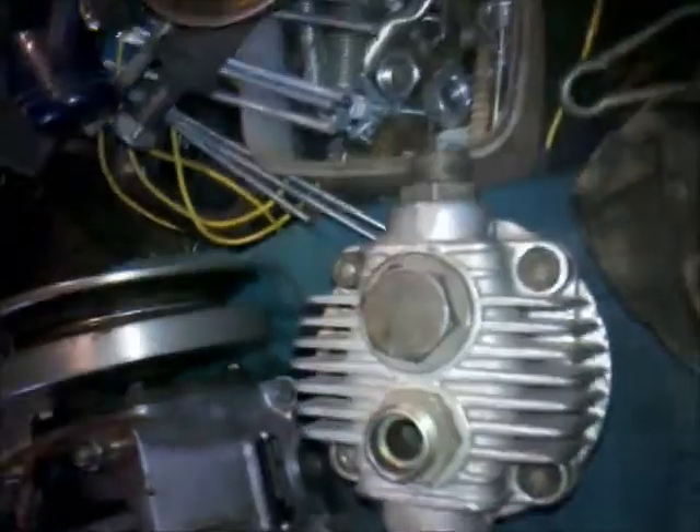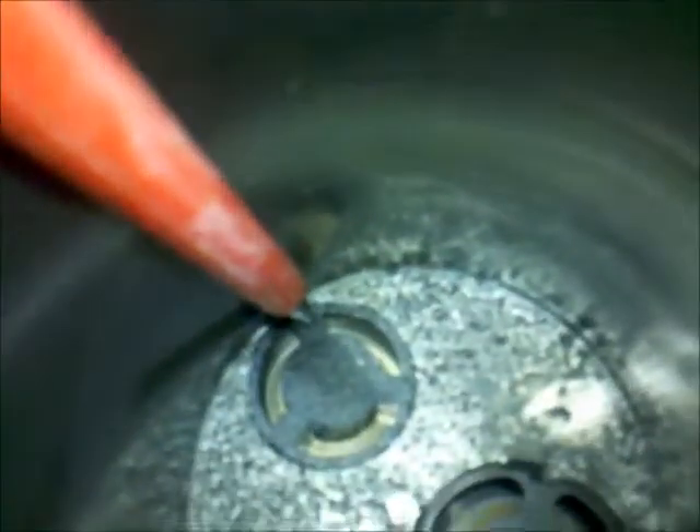On the other hand, the cylinder and the cylinder head — the cylinder itself looks pretty okay. It needs a hone job, it is pretty polished. But the cylinder head also has pitting. Something broke out of the head or the valve, and this little piece got pounded many times. I think this is the issue.